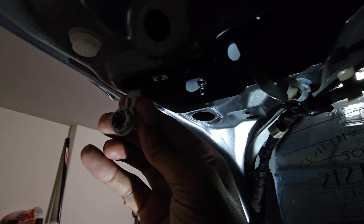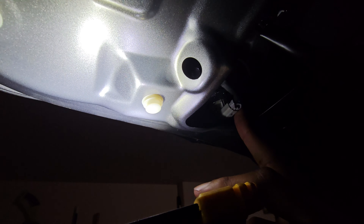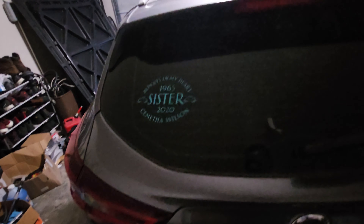As soon as I pulled it out the bulb came out, so it's like the bulb wasn't even locked in place. I don't know — maybe this car went to Nissan and they didn't put it back together properly. There is a tab, a little prong right there that's keeping you from twisting it to the left to unlock it. So you can kind of press down and push it this way to get it out of there. That prong gets in the way when you try to unlock it and lock it back in place.